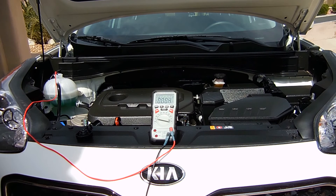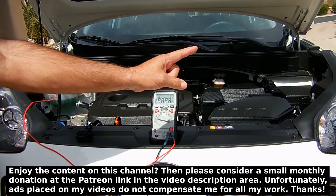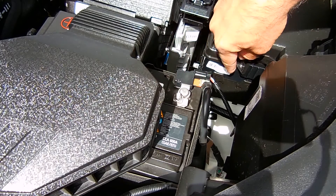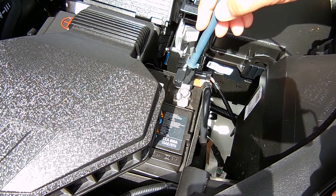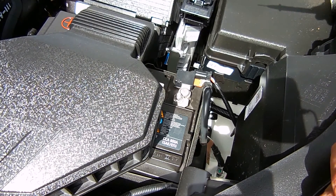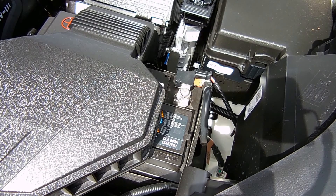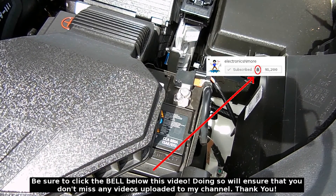If the level was above 0.33V, you're going to want to rule out poor grounding as a problem causing the voltage to be high. Disconnect the negative clamp from the battery and push it to the side, then repeat the test — leave the red probe in the coolant and touch it only to the clamp or a clean spot on the engine block. If the voltage goes lower, that indicates a problem with the grounding system — current is flowing through the coolant instead of a wire. But if no change occurs and the voltage stays elevated, that's an indication you need to replace the coolant.